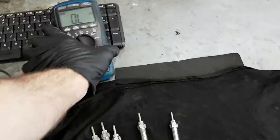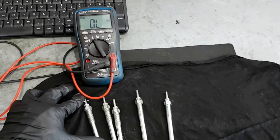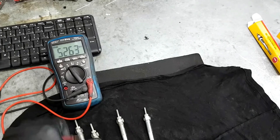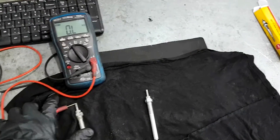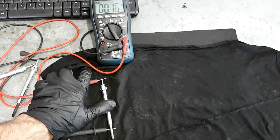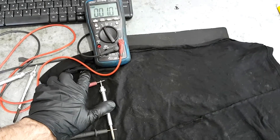We've got our four old glow plugs out and we've got the new glow plugs here. We'll do the old school resistance test just to prove that our method is sound and see what results we get. That's an open circuit glow plug — another open circuit, another dead one. And for the set, all dead. If we get our new one — that's stabilized at about 1.7 ohms or so, so it's a good new plug. We'll get the four in and redo our test on the scope and see what results we get.